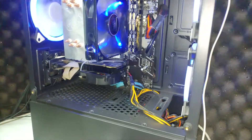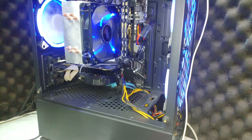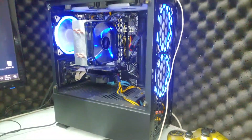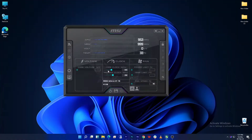Now, as we have prepared our passive GPU with active cooling, it's time to overclock and push it to sky high. Remember, not every card overclocks the same — some you can push more, some you can push less. But increasing the core clock little by little to find the stable overclock is the key to success. I am using MSI Afterburner to overclock because you can save the stable clock and switch back to normal when you're done gaming. For this GPU, I was able to push it to 1300 MHz from 950 MHz on core clocks, and 1000 MHz from 800 MHz on memory clock.